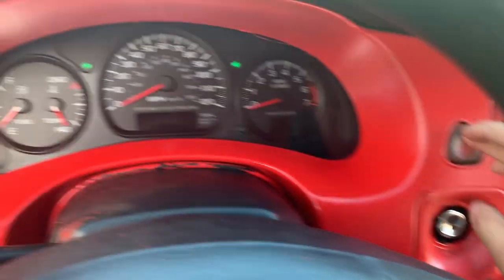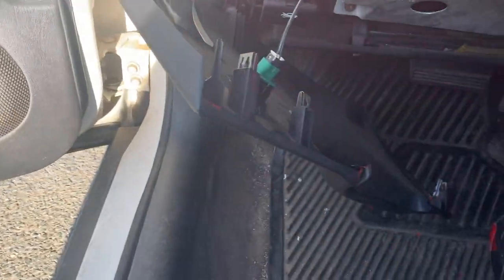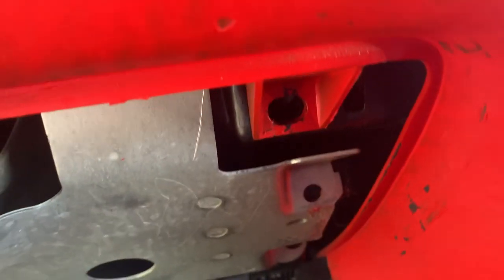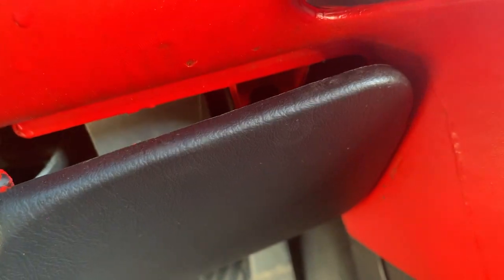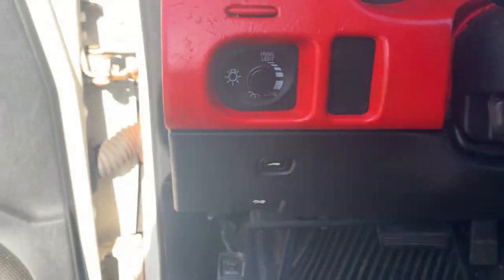Click the button to make sure the hazard works. Then put that screw back in, put the screw back there, and get those bolts in on both sides. Come down here, there's a slot on this side and a slot on that side — line it up and press the clips in. Same over here.